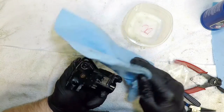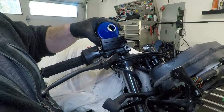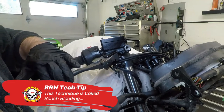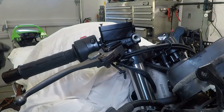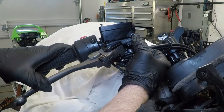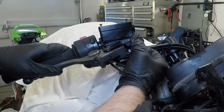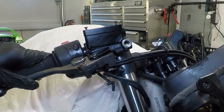Pretty easy overall, but the next step can be frustrating — the first time I reinstalled a fully bled brake system I felt just that. Getting fluid moving through an empty master cylinder can be difficult. The trick is to get the fluid pressure built up and a steady stream of fluid exiting from the ports before attaching the brake line and banjo bolt. To do this I pump the lever a few times to get fluid from the reservoir down into the cylinder. You can see air bubbles escaping from the compensating port. I then cover the master cylinder port with my thumb and pump the brake lever. Holding it down, I release my thumb from the port and let air escape. Covering the port to make sure it's airtight, I can then release the brake lever and repeat this process until brake fluid flows naturally through gravity.